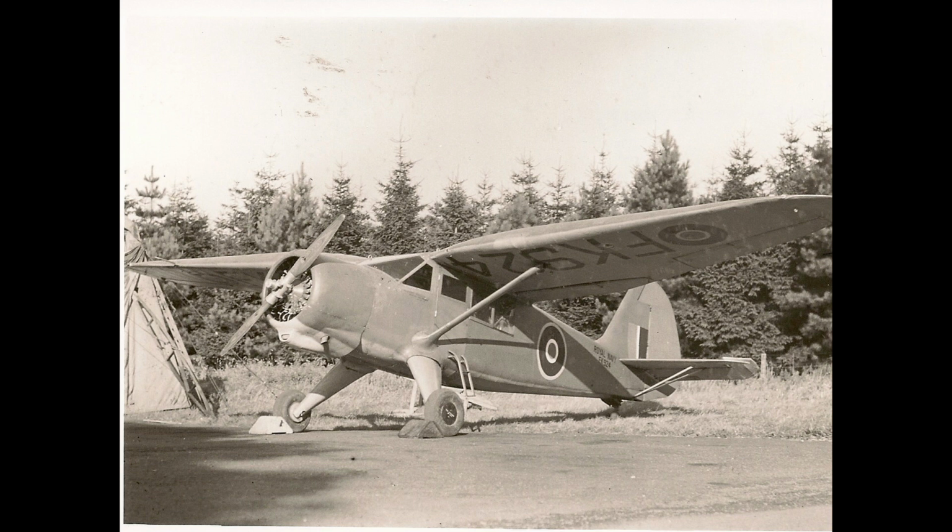But the wing is all metal. Like I mentioned, the main spar, which is a huge truss-type spar setup, is 4130 steel. It's got a made-up I-beam aluminum rear spar. The wing ribs are all square aluminum hollow tubing. The only wood in the wing is just the leading edge former. That kind of helps just keep the shape of the leading edge for the aluminum to fare around.